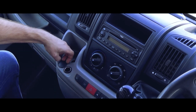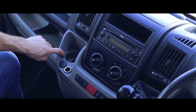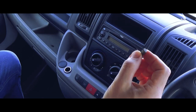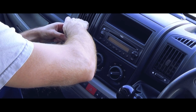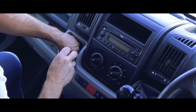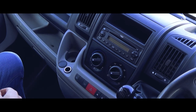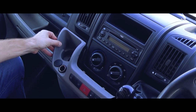This is just a blank, and I'm fitting two new sockets in there. First thing to do is take this off — this whole section here. T25 bolts. If you have a rubber mat in the bottom of your cup holder slash ashtray holder, you need to take that out first to reveal the screw underneath, then lift it up and pull it out towards you.